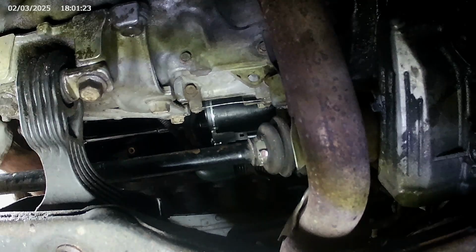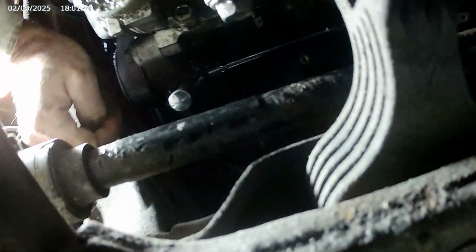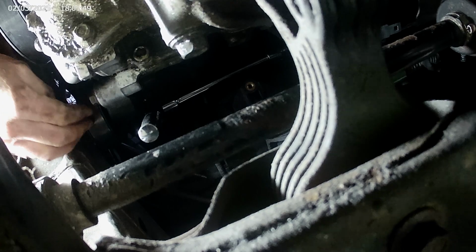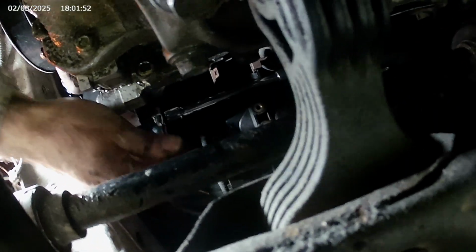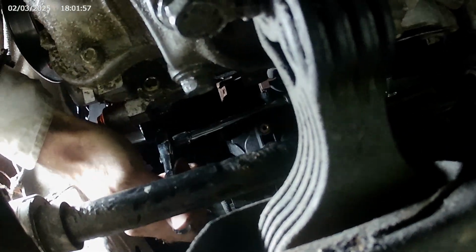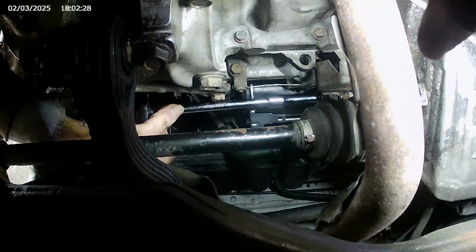To get access, I'm coming up through the passenger wheel well. So I've got 9-inch of extension on there. You can see here's my serpentine belt, and this is where I'm coming in to get some leverage to tighten this. Notice with the combined 6-inch and 3-inch extensions, you can reach the bolts straight without a universal knuckle joint. If I had longer extensions, I'd need that knuckle. And I use the same for removing the bolts. And the same on the bottom one.